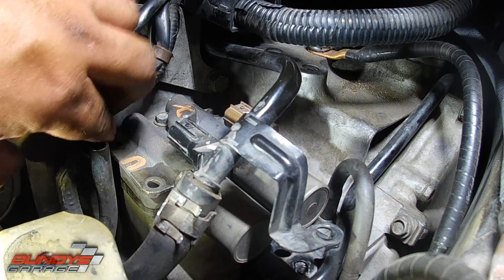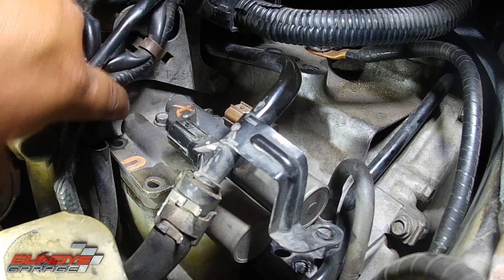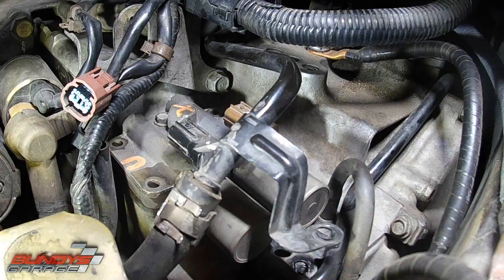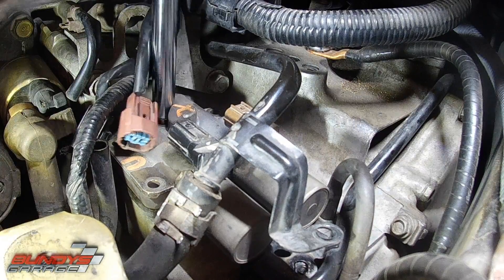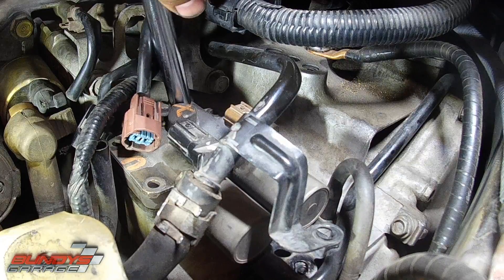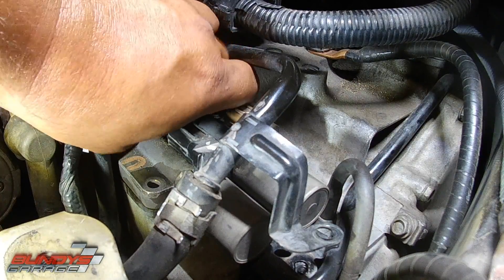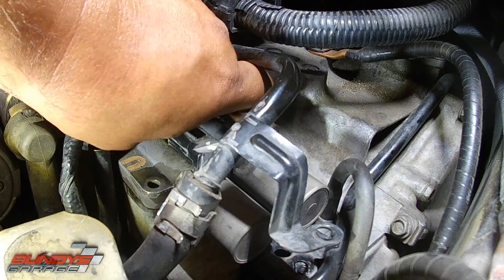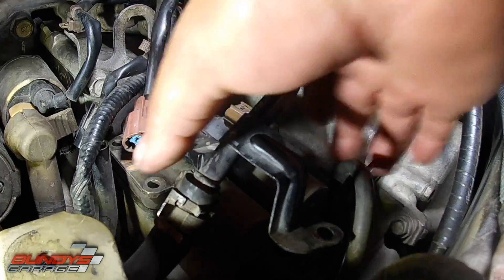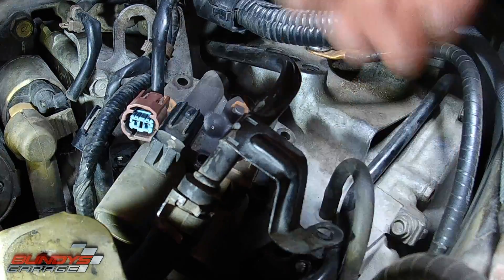There's actually six bolts — there's one right here where my finger is. I totally forgot; I told you guys five. There are six. The other solenoid I referred to as the AB solenoid has already been replaced on this vehicle. So the last Hail Mary is to replace this linear solenoid with a known good one. This should just pull up and get it out of the way.